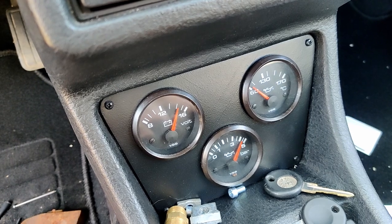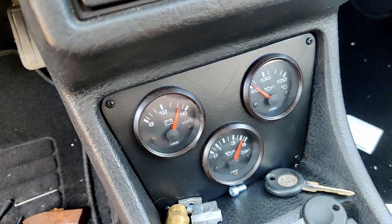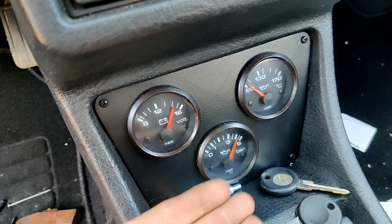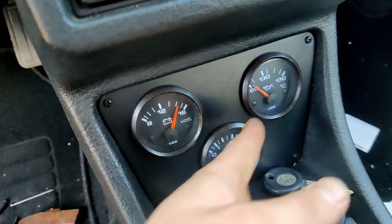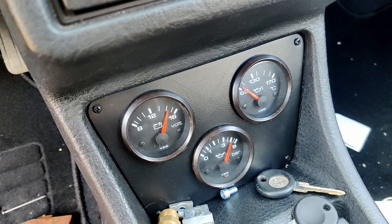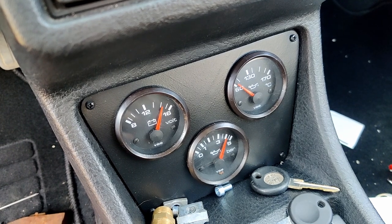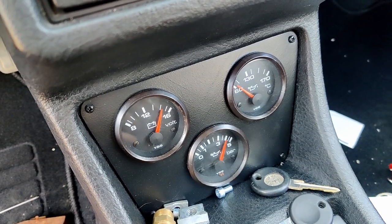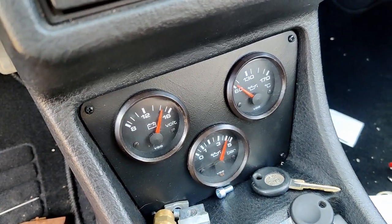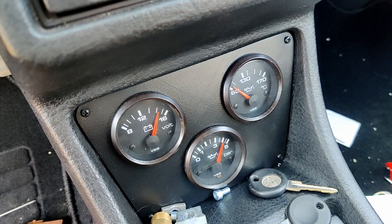After I consulted with a bunch of mechanics, all of them said that it's probably the oil pump. So that will be changed soon, because I really do hate the fact that when the oil gets warm, the pressure drops. It's really, really annoying. That's the major issue with the engine right now. But other than that, I think it has almost all of its ponies, because it drives really good. But I don't want to drive it, because I'm afraid that because of the oil pressure problem, I might damage the engine.